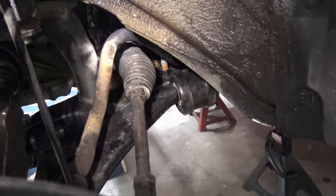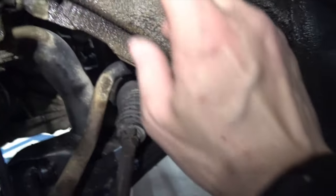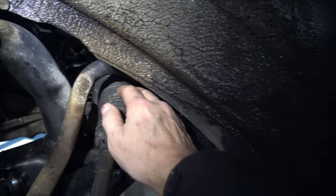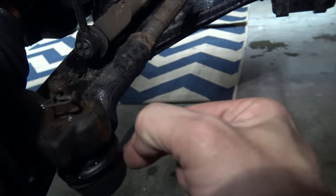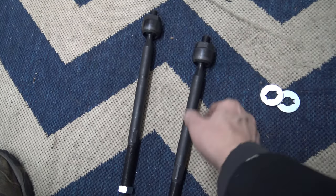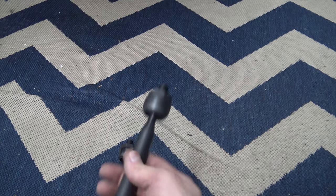So that's what the video is about today. It could take me a couple of days the way I work, but we're going to replace the inner tie rod ends. Now of course they're behind this rubber bellows, and there's a ball joint here. I've checked the outer tie rod ends and they're not in bad shape — no apparent movement there. These are my new inner tie rod ends. I'll put a link below where you can get them — they're not expensive, $35 and I got both left and right.